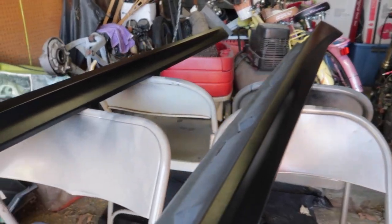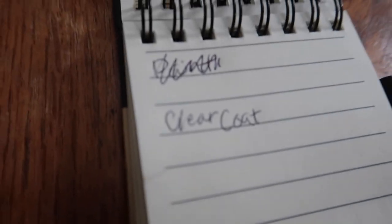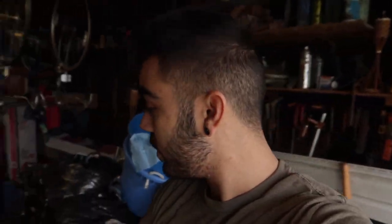Check this out — ten times better. It actually looks black now. I'm going to put one more coat because there's just a little bit of unevenness. It seems like I prematurely ripped out the checklist, so we're going to add clear coat. There's a lot of lint and dust on these things, so I got another tack cloth — these things are awesome — and I'm going to wipe them both down. Then we're going to get this clear coat going. The clear coat I got is the DupliColor Perfect Match clear coat. This should be the best one because I used DupliColor for the actual paint.